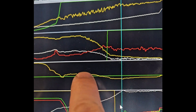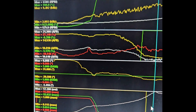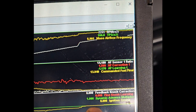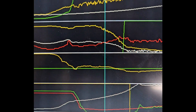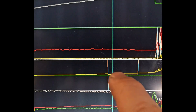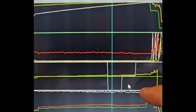After a number of changes and multiple pulls, we are now able to maintain zero ignition timing correction. We still have the same timing coming in right where we were knocking before — we were at eight degrees, we're at eight degrees right now — so we didn't change the timing through there and we're not knocking. We've done multiple pulls in a row. But we've turned it up a lot and now we're getting a little bit of knock up top, so we're going to clean that up. That's tuning — you just clean, change, make changes, until the car is ready to go.